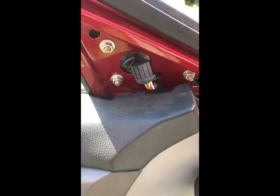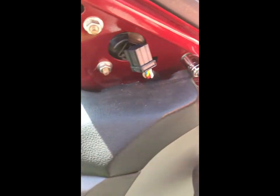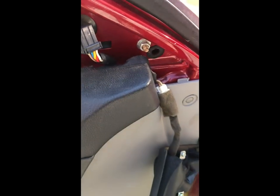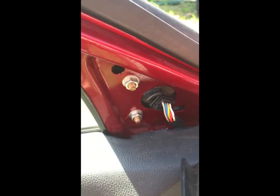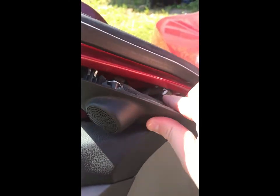Literally all I did was screw those down, and actually this little extender has helped me because if you look there's not a lot of clearance there, so it'd be hard to actually ratchet there. Once again this is a 10 millimeter. So these are all tight, then you just take this — your power mirrors connector and everything like that — and stick this back in, preferably without breaking it.